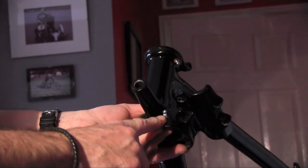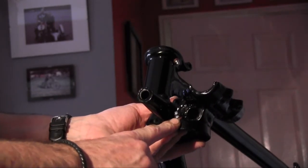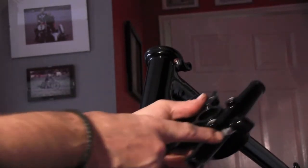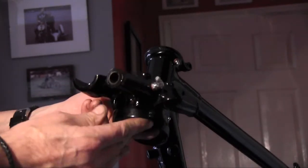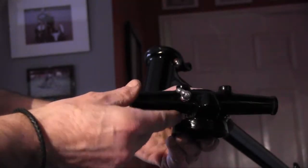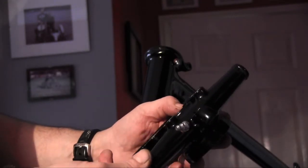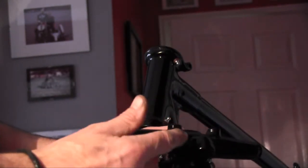Plain upright grease nipple on this one, normally find best. Steering head, I normally put side ones on the spindle. Yeah, I normally put side ones on the top. This one hopefully comes out in about the right spot, but you can always change them around once you've got the bike assembled. And actually, if you want to, you can fit the other type.